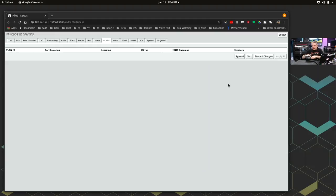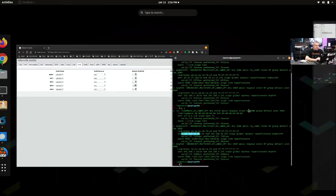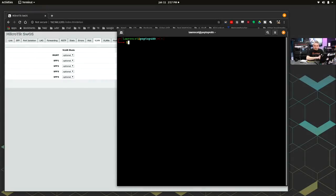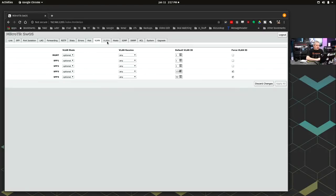If I don't explicitly define the VLANs here, because they're defined elsewhere in my network, I believe it will still tag and pull the VLAN tag on these ports. We're all learning together right now. So I've done those but left the force VLAN ID on. We'll wait for the computer to negotiate the connection... and yes, the 1337 address. Even if you don't have them defined here, it still can pull the tags.